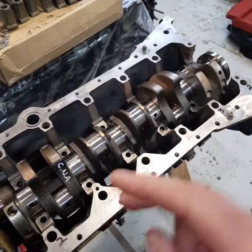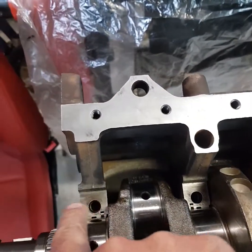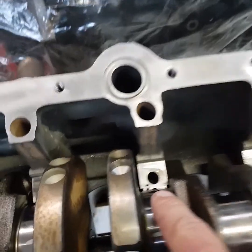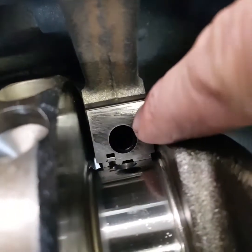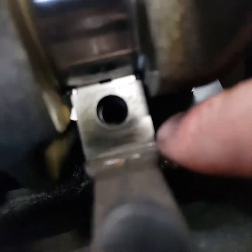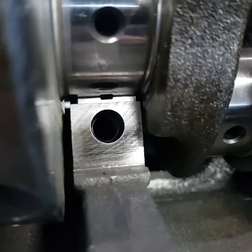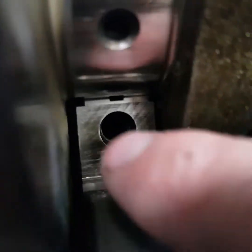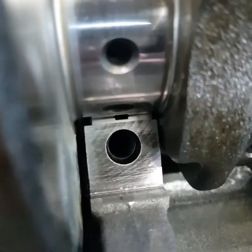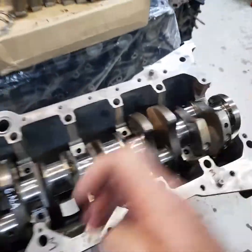As an interesting fact, that's what I do — I normally take a file and just to make sure there's no rough burrs or edges sitting on these. Sometimes you find a little lip — maybe you can see on that one there where it was machined. There's a little lip, and sometimes that can cause your clearances to be out. So taking a little file, you can see they've filed it. There's a good example — you see where the little high spots were on that. Just to get that centered and better. You see this block's also been deburred, so this has basically been readied for assembly.